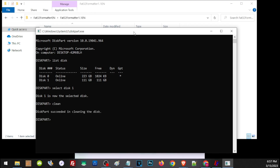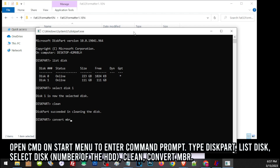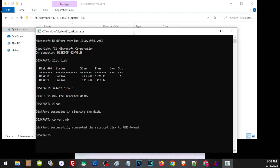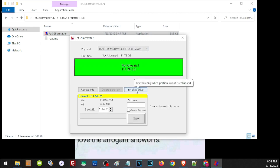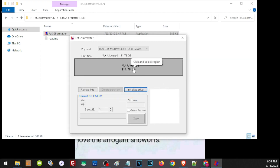When you are ready, type in CLEAN and press Enter. We have now successfully formatted the hard drive, and from here it is ready to change the partition. To do that, type in CONVERT MBR. Quick recap: type CMD on the Start button, select Command Prompt, type in DISKPART, then LIST DISK to check all available hard drives, select the disk, CLEAN it, then CONVERT MBR. Now we have changed the partition to MBR. Run the FAT32 formatter — it can now detect the hard drive. Click on the drive, Initialize, click OK, click Quick Format, then Start.